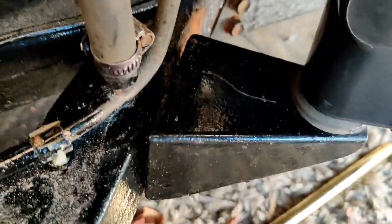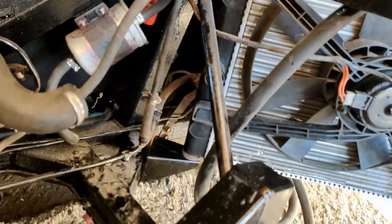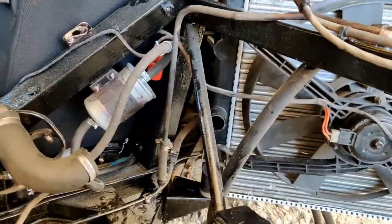Halfway through with the tool - you've got a nice straight edge. Okay, after a lot of messing around and about another hour and a half, I've had to move that bracket to there, so I've had to drill and tap the chassis. I've had to move that bracket over and drill and tap the chassis again. I've had to move that one, drill through the body, and move probably another one too. So basically all four of them have been moved. That radiator now is rock solid - it's better than it is in my own car to be honest.